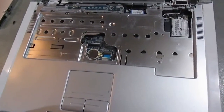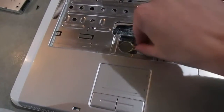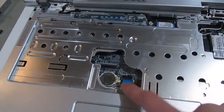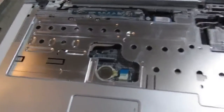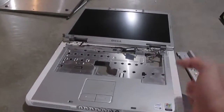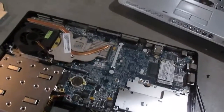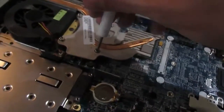I got that off, and I'm definitely going to have to remove the hand rest, but that's not a big deal. I'll probably need to remove the button board as well, but again, not really a big deal. I wound up having to remove the screen as well as the bottom plate, but now we have access to the CPU, heatsink, and probably GPU as well. We'll get to removing this now — I can probably do it on camera.